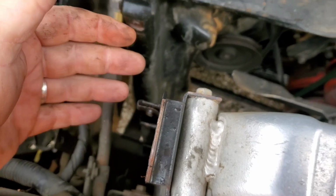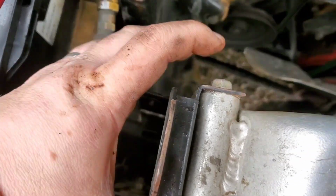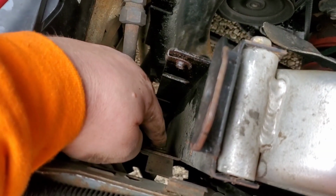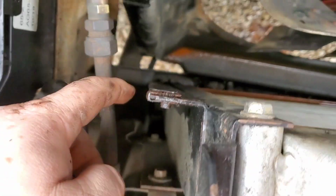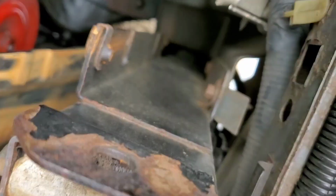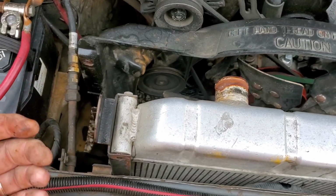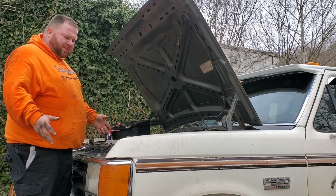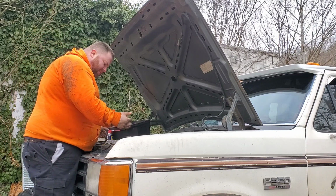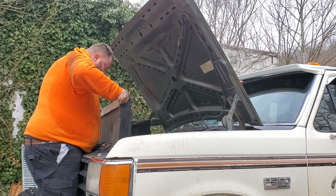Right, now at this point, the radiator's drained, got the hoses unhooked, fan shroud's out of the way. So there's these, I don't know what you call them, caps, I guess, that run all the way down the sides. And there's 4 bolts. There's one here, next one down, and they use these slots here to allow you to get a socket back there. And then there's 2 more on this side. Those are 10 millimeter, so go ahead and remove those at this time. So now we've got everything unhooked except for those 2 end caps. So now this is the point where you really needed your Wheaties for the morning. And you lift everything straight up.